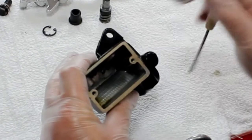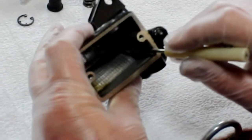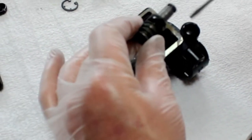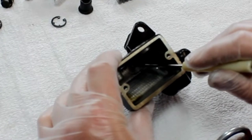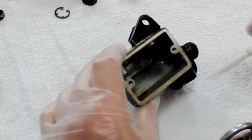As we look around, we have two holes or ports. The larger diameter port is the feed port and it supplies fluid right at the threaded area of the piston here. This looks like threads and then engages the seal and pushes it inward. This is the relief port — this is how fluid cycles back into the reservoir when we release the brake lever.